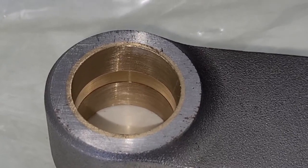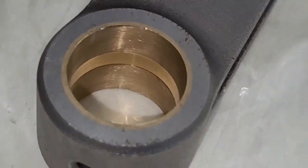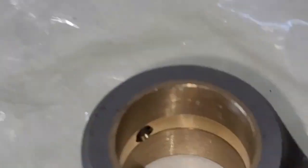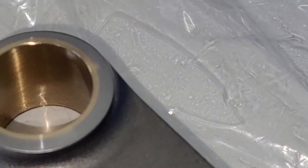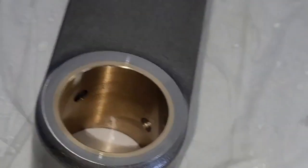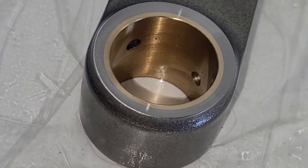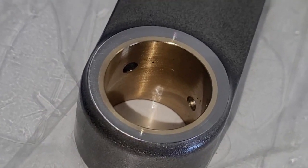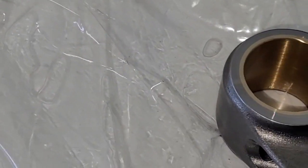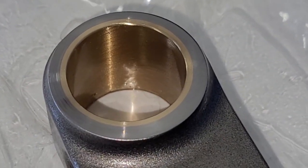On the Crillo the small end looks like it was ground very smooth. The Max Speeding has one oil hole in the top to feed oil to the bushing. The Crillo's bushing looks smoother and it doesn't have that oil feed trough — instead it has two oil holes, both on the bottom. I would think that's better because most of your splash lubrication is coming from the crank and getting slung upward. So this bushing would get lubed a lot better, and it has more surface area since there's no oil channel machined into it.